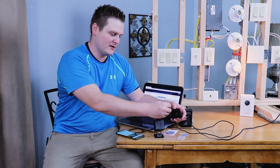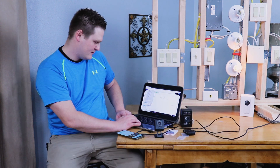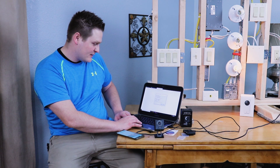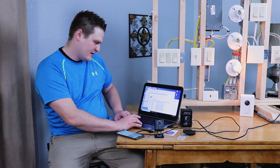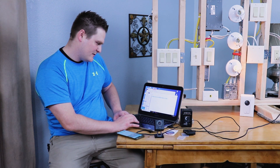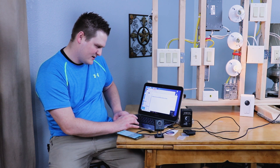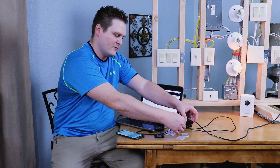Format the SD card — put it into the computer and do a format. Make sure it is FAT32, otherwise it will not work. Then go back to the Wyze Cam RTSP page, select the first one (not the Cam Pan), and save the file to your desktop. Right-click, go to Rename, make sure it's demo.bin, hit Enter, then eject the card from the computer.